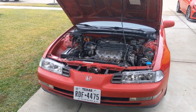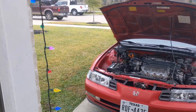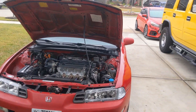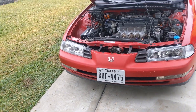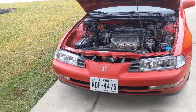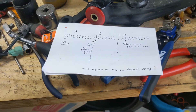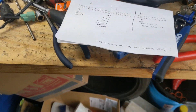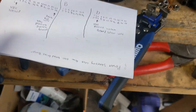After searching through a little bit of forums and looking up a few things, I'm going to have to pin in the VTEC solenoid and the VTEC pressure switch — just like I thought. I was just making sure that the harness didn't have a connection on it that the guy had cut off or whatever. So we're just going to wire it straight into the ECU. I have the pin out here — a really quick drawing I did to help people understand. It's ABD, not ABC.